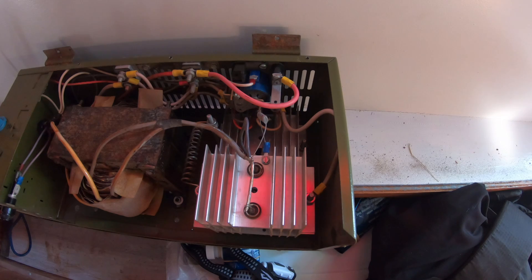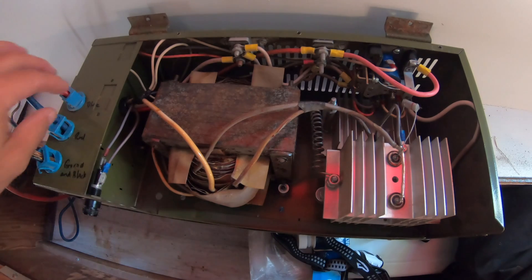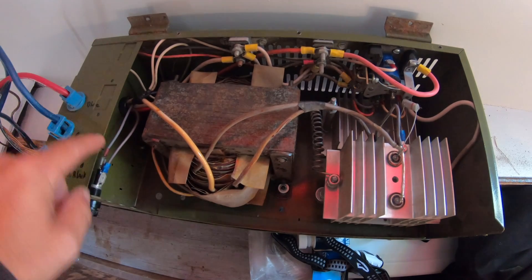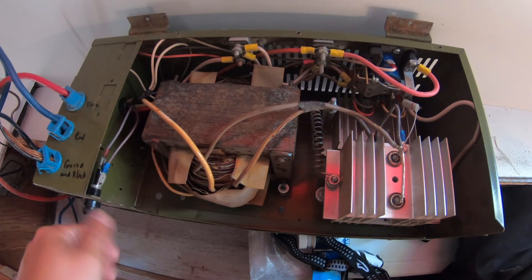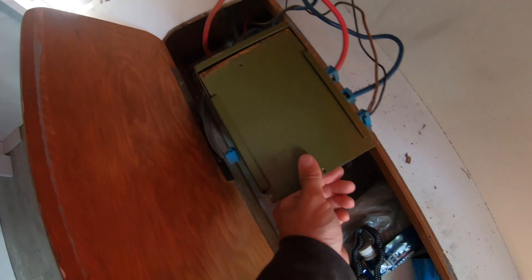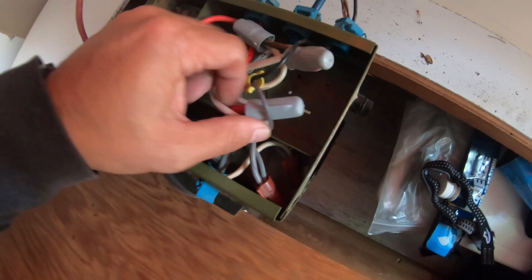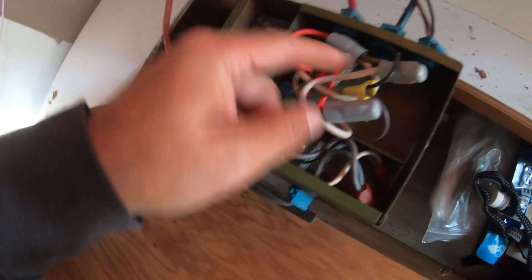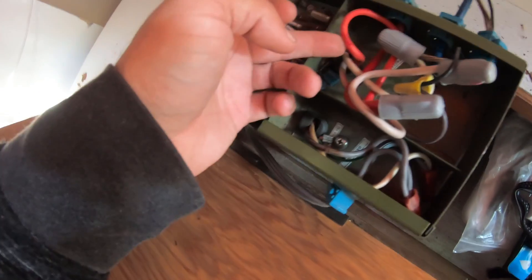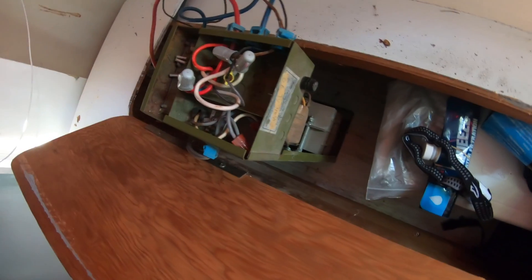With an RV, it's like a box of chocolates - you never know what you're gonna get. There's no way for me to see inside this panel. This is my fuse obviously, but I can't actually see where these wires are going. The unit does have a front panel I can take off though. The red comes up into here and gets capped off, then the red goes in and the blue goes to a white wire - so red to red and red to white.